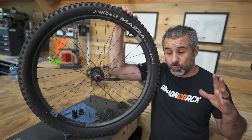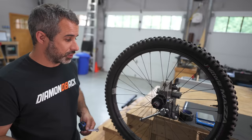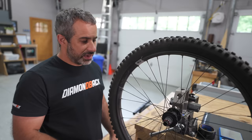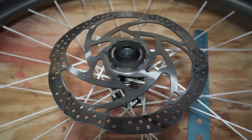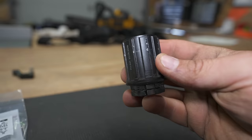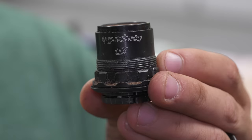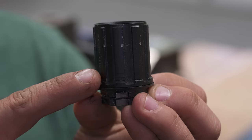Tires are pretty simple, but wheels are not. First, make sure you're looking for mountain bike wheels, as they differ from road and BMX wheels. If you have any question about wheel size, just look at the tire — '27.5' tells you the wheel size. There are also rear and front hubs, and that matters if you're replacing just one wheel. A front wheel has a mount for your disc brake rotor; a rear wheel has a spot for your cassette. On most mountain bikes you'll have either an HG driver — for Shimano-type cassettes with a continuous spline — or an XD driver for SRAM cassettes, which has small splines at the bottom and some threads.